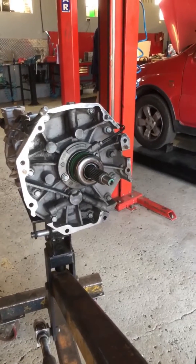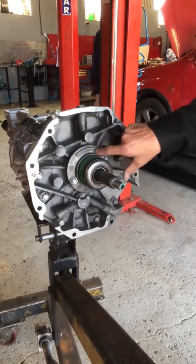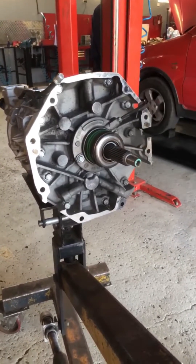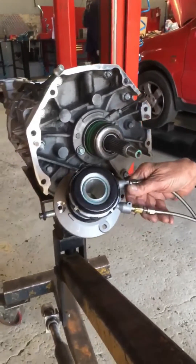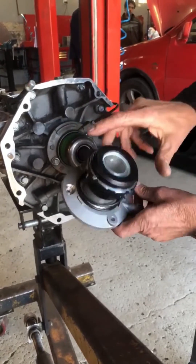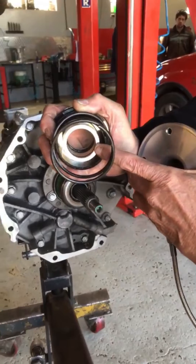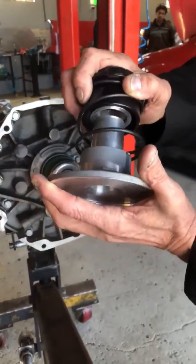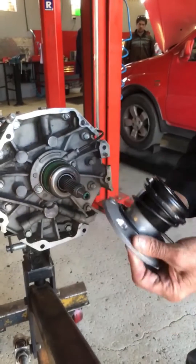The transmission we're fitting back in the Shelby is a T56 Magnum. It has the original FTE concentric slave. We're replacing that with one of our billet alloy concentric slaves — multi-fit — that suits a variety of cars. It's got a billet alloy piston for strength and reliability long term, and double O-ring for smoothness. And that's the one that we're going to fit.